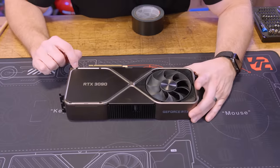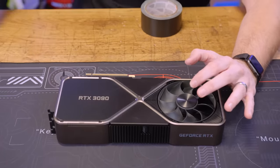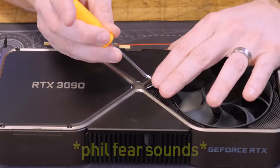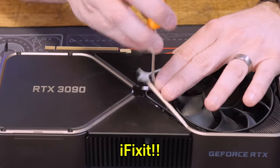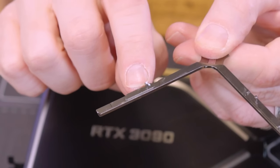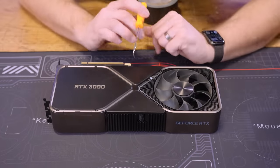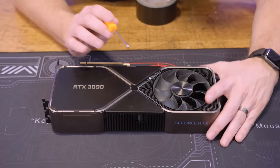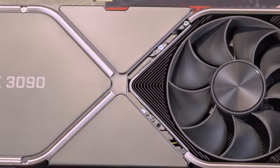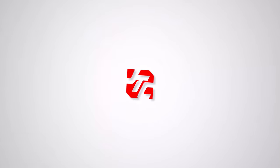That exposes our little tiny T2 Torx screws or whatever size they are. But first we have to get this piece off right here too. This little cross brace right here is just held in there with a little ball joint. One thing you got to keep in mind — see these little nubbins right there? See how that one has goop there because I lost one of these — and there it is right there. It was a thermal pad stuck in the hole right there. If you look in this side, you see a little rubber thing and that's what it's supposed to stick in. I lost it when I tore this down last time when we were doing the thermal pad mod.